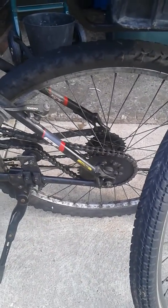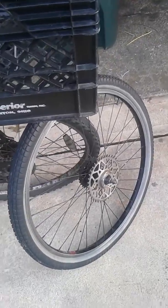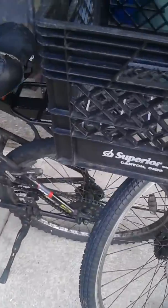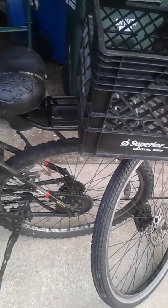I'm going to switch this bike over to a free hub too and use this wheel as a spare. I recommend getting rid of that rag joint — those things are junk and will destroy your wheels. I highly recommend the Russian sprocket. I've got a 39 tooth on this wheel and a 35 tooth on the other one. With a rear disc wheel the Russian sprocket just bolts right up and you're done — no fussing around trying to get the rear sprocket even.